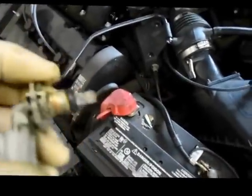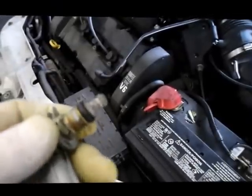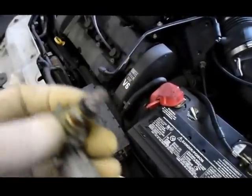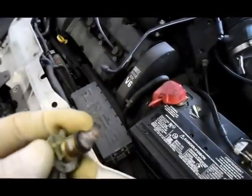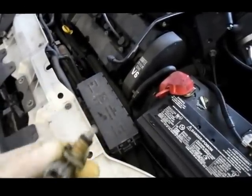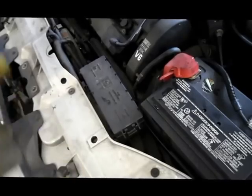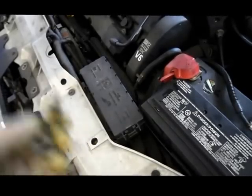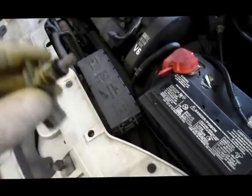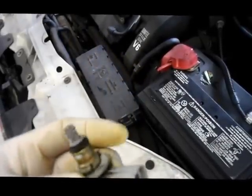This is the old sensor. I got the car running now, so sorry about the noise. It's just hard for me to believe that this sensor would cause the car not to idle or anything — not even to crank over. The way it started is that the vehicle would start up and run, you'd drop it into drive and it would die out, you'd try to crank it and have no spark, but you'd sense rotation.